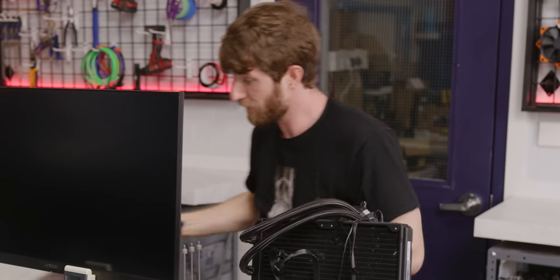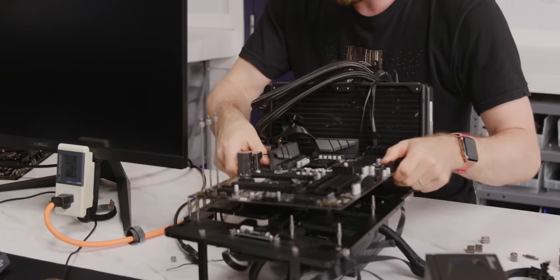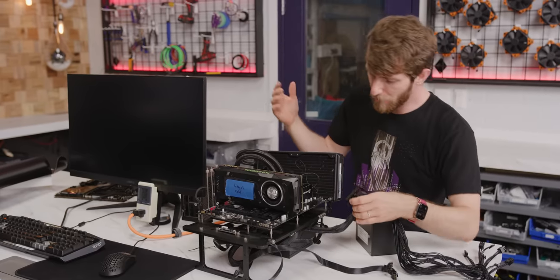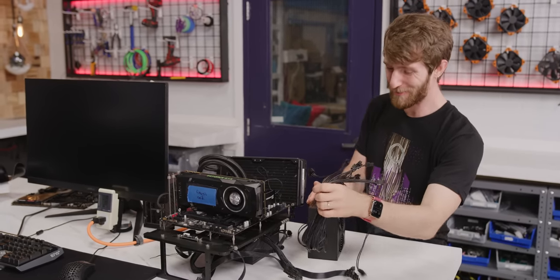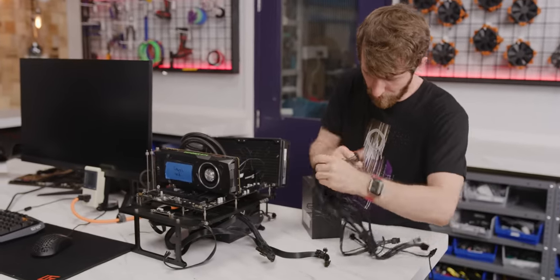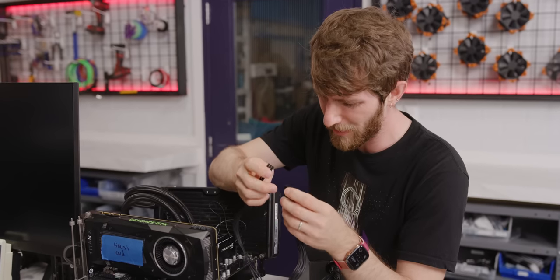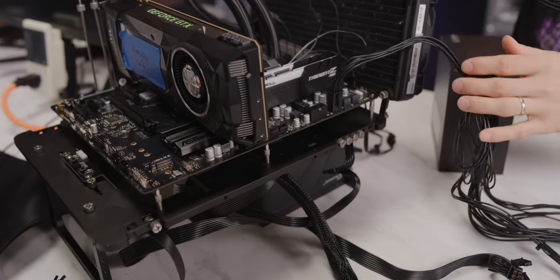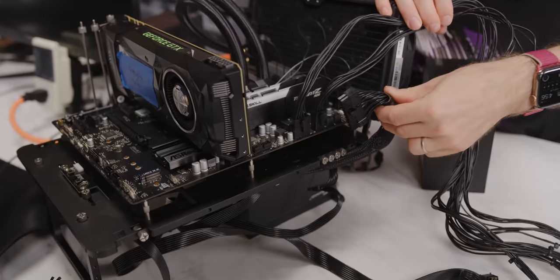I do still want to give it a crack though, given that this motherboard is marketed as — gaming is right in the name — and it would be pretty atypical for a gamer to not at least have some manner of discrete graphics card in their system. Hook up the new power supply. I've seen articles about this, but I'm pretty sure I'm the first one to actually hook one up outside of a lab. The fact that we have so many pins — 10 plus six, so 16 pins total — sort of raises the question: why didn't they just do two eight-pin connectors, which we already have? And if they didn't want to reuse existing connectors, why did they use a PCIe six-pin? It just seems like if part of the goal was to reduce the bulk of the connector, mission not accomplished, because it's very similar in size.